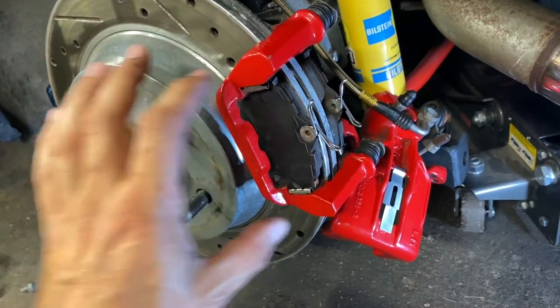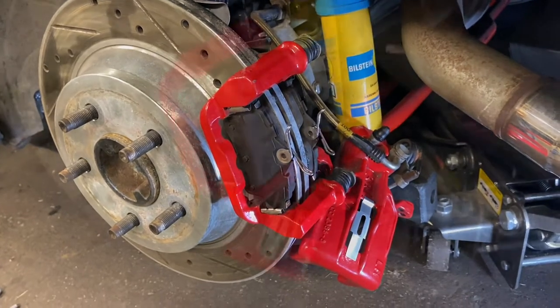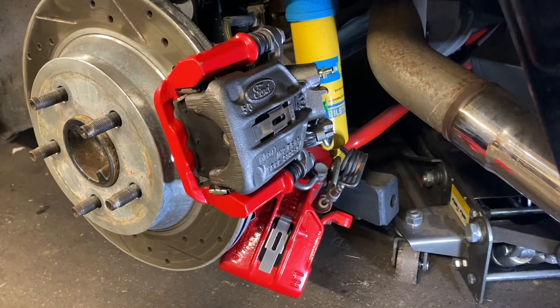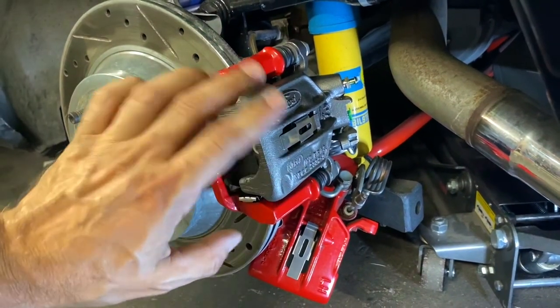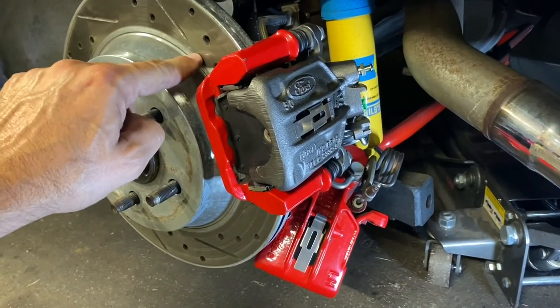So if you order the caliper like this, you're going to use Mustang rotors and Mustang abutments. If you're using Cobra you've got to use the Cobra setup — Cobra abutments, Cobra pads, Cobra rotors — and after that you just bolt the Taurus 43 millimeter caliper on. Here's the Taurus caliper bolted in place. Those of you who have seen the thread on SVT Performance will recognize this shot — this is essentially what I did back then when I proved this out.